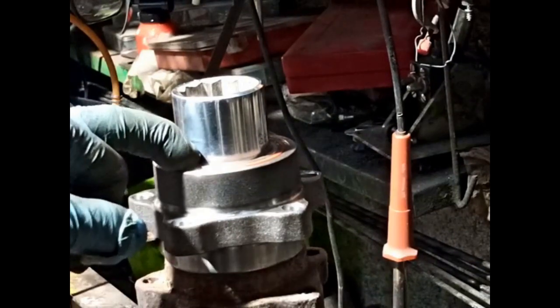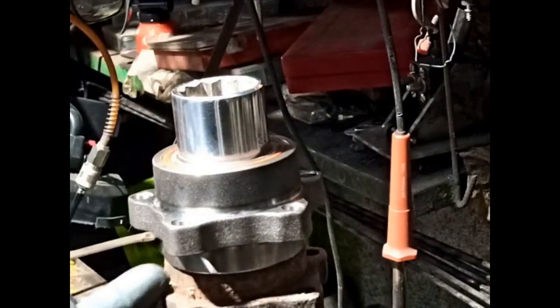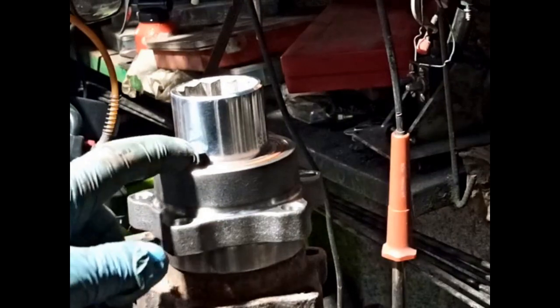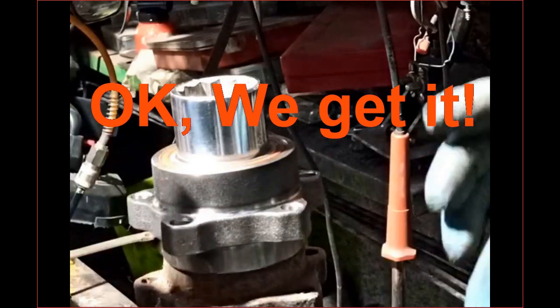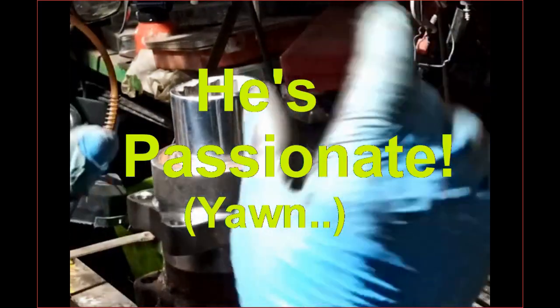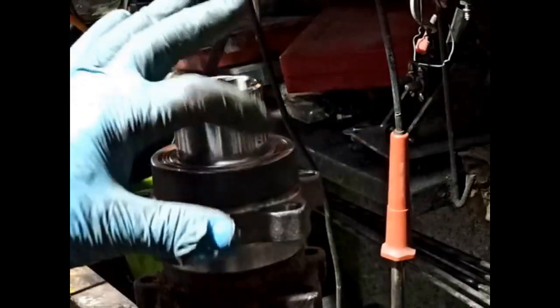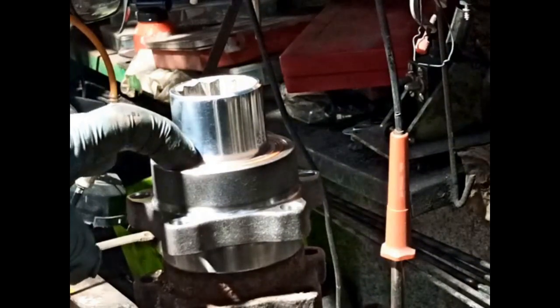Anyway, the idea is that you put the pressure on the inner race, because if you put the pressure on the outer race, you're actually damaging the bearing. That one's all right, because that inner race is being forced against its tapered bearings. But these tapered roller bearings come in the opposite direction, so you're actually straining this here, and you're damaging the surface, you're damaging the seals, you're probably shortening the life of the bearing in that way. I hope that makes sense. If you've got bearings like that, and you're pushing on the outside down, and the shaft of this is pushing on the inner race up, you're at odds. Even if you've got something covering both surfaces, there is that tendency for any clearance between this and that to be filled with that, and you're damaging it. So you want to get your downward pressure on the inner race.